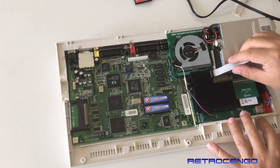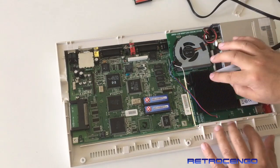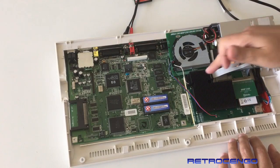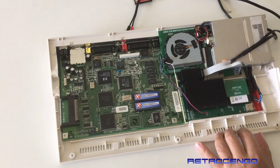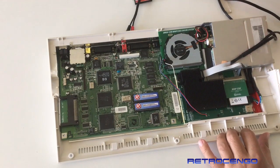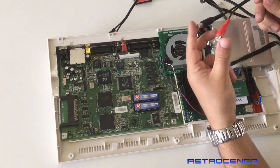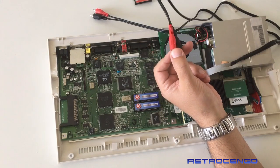The way it goes is, you can install it here — I'm just going to show it. From here you have got these cables, as you can see. They will go into the Amiga's native sound output. So this will be an input to this card, and from here to the monitor. It is not programmed, it is not finished yet, but it is on the way — it is just a matter of a firmware update. As of right now, you can actually use your RGB out and use the video sound cables from there, put in here, and through this connection you will have sound from your RGB out also.